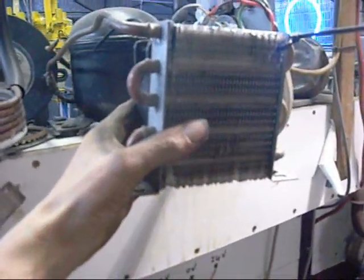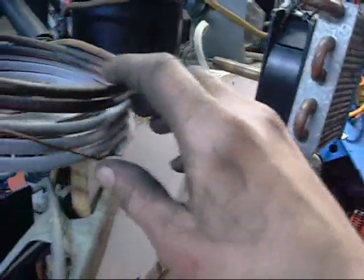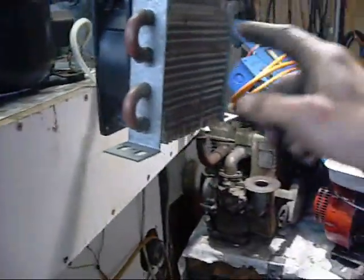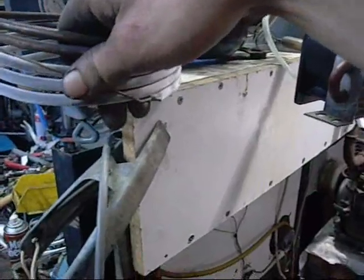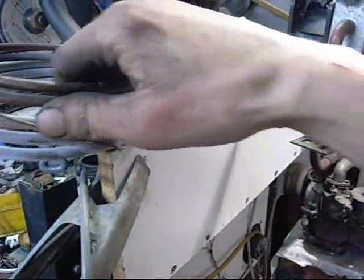Even the mutilated bottle cooler is getting a good workout today — starting to freeze up, with a bit of heat rejection there. It's working really well. These things are the best way to understand the refrigeration cycle: in a nutshell, there's a compressor, high-pressure discharge coming off it condensing into liquid via fan cooling, out through the filter dryer, through the capillary tube, metered into the evaporator tube, then returning to the compressor on the suction side. Really straightforward. Getting the right balance of evaporator and condenser size and the right compressor for a system is sort of an art that refrigeration mechanics or engineers really know.